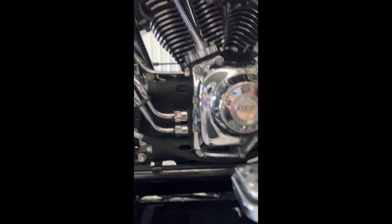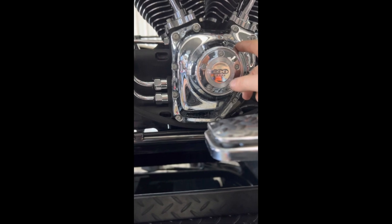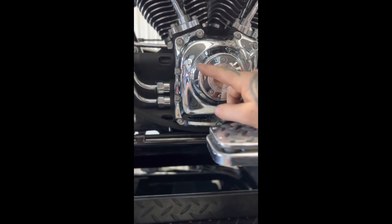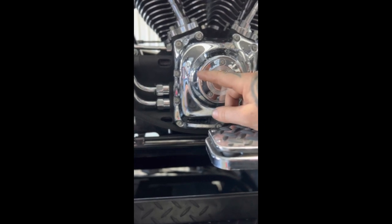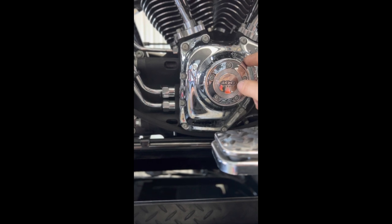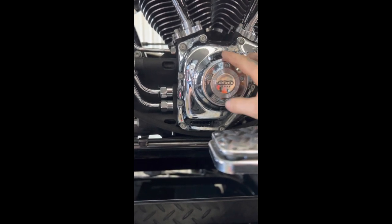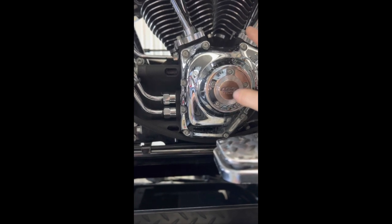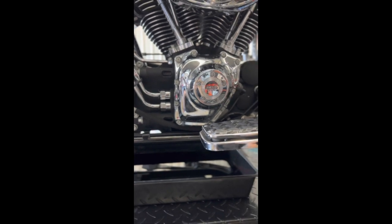Rocket's concerned in relation to the tensioners. From the pinion, it comes off the crank with the gearing that goes across your cam plate up to your cam drive, and then on the inside we have got the cam chain itself that controls both cams on the twin cam to run in timing. We'll get it apart, have a look — we have got some new ones here to put in.